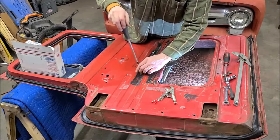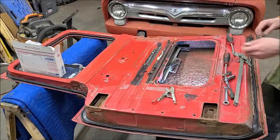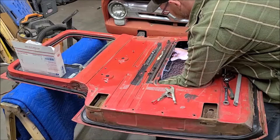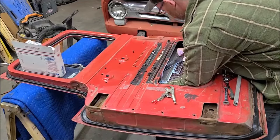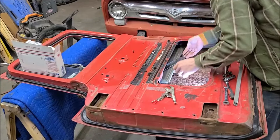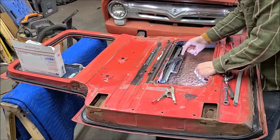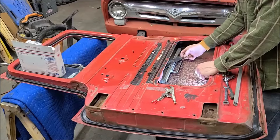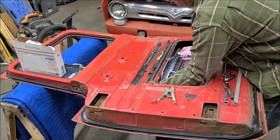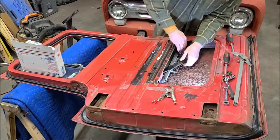What I've done in the past is get wood shims — like you use for shimming a house door — and pull the window up and put the little wood shims down in there to bind the window and keep it from falling down. I've done that before on other window or door projects and it works just fine. The regulator fell down, so I'm going to slide the regulator for the window — not quite sure what I'm doing here, but I think this thing is supposed to slide off the end.